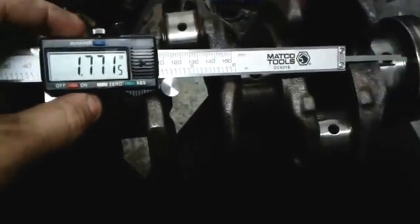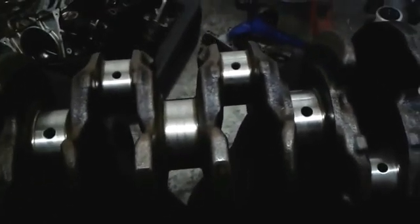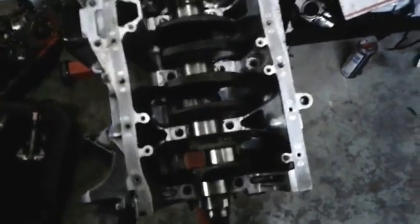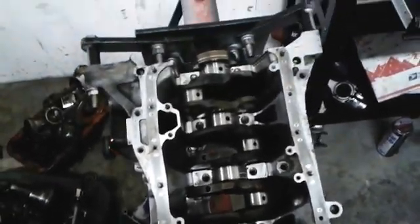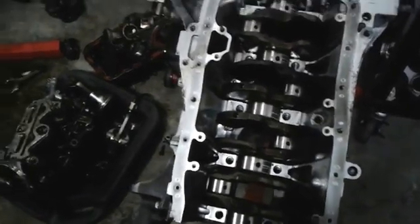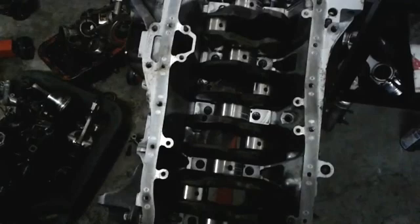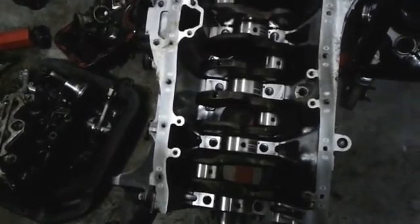This tool is definitely really important. Even though, generally speaking, if you eyeball the crank and it seems to be good, it usually is. This crank could probably use a professional polishing. There are tiny imperfections. I could and have polished my own cranks before, and I probably could polish this up to where I'd be happy with it. But I don't really feel like taking the time to do so, and I know it's clean enough to go in. Do you have to polish a crank before you use it? The answer is no. What most people get mixed up is polishing a crank versus cutting a crank. Polishing a crank doesn't really remove material — it just takes out tiny imperfections to smooth out the surface all the way around.